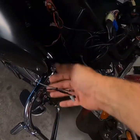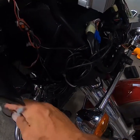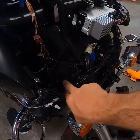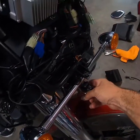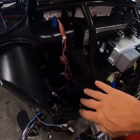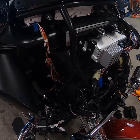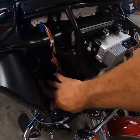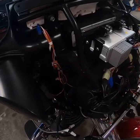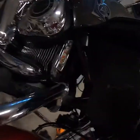On the other side I've basically done the same thing — I've added a Polk speaker and pulled the wiring harness down through. I'm just going to clean it up, tape it, and stick it back up in here. All this extra wire is camera wire — I've done a front camera and rear camera — and it's easier to tie it all up under here than to cram it under the seat or mount it in the back. There's plenty of space up here, this entire area is open and not being used for anything.